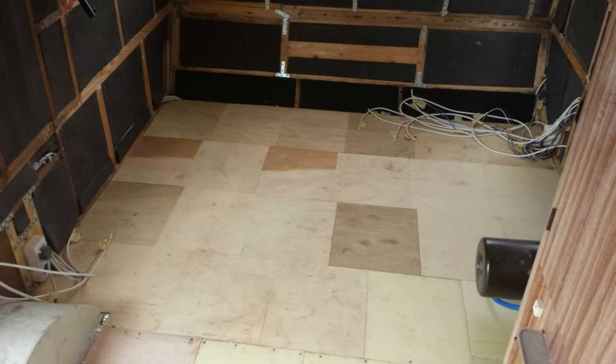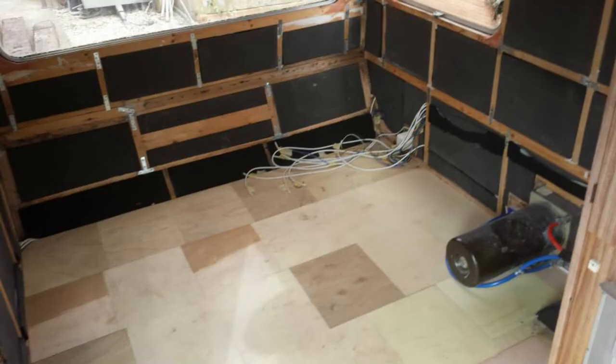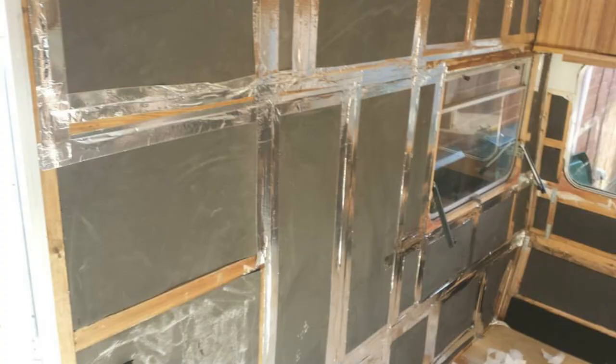Continuing laying the plywood squares down onto the floor. That's the other end of the caravan done, and all the way through. All the same thickness — I think they were three or four millimetre. Pinned in place, covering the whole floor. So you've got the space-age insulation, then the original plywood floor, and then the new plywood squares on top. This is me filling in all the gaps with an automotive flexible body filler, then going around the wall insulation on the battens with aluminium tape.